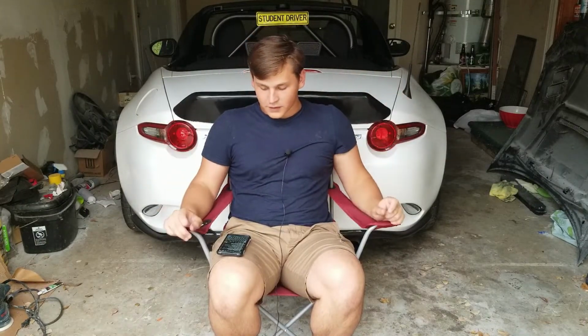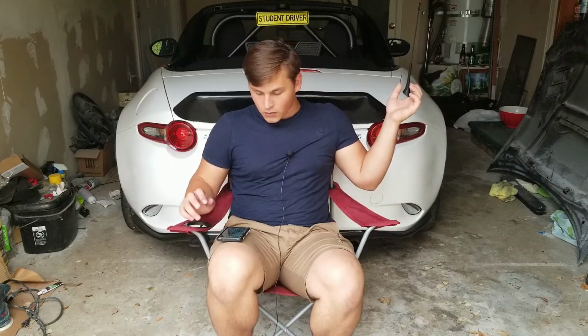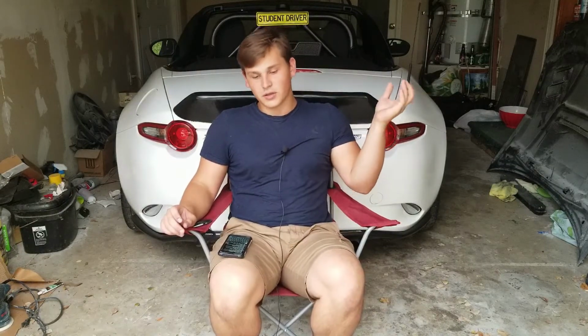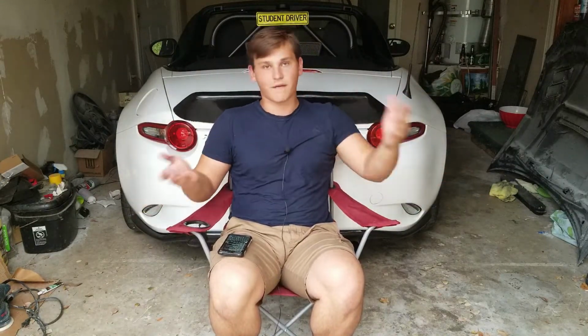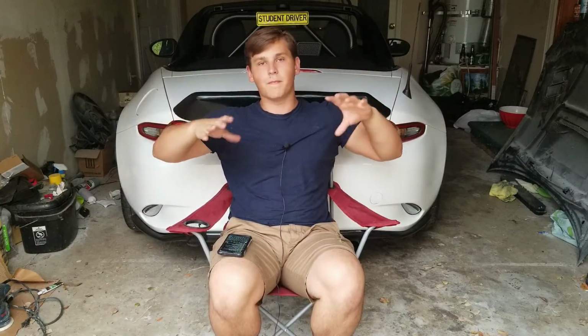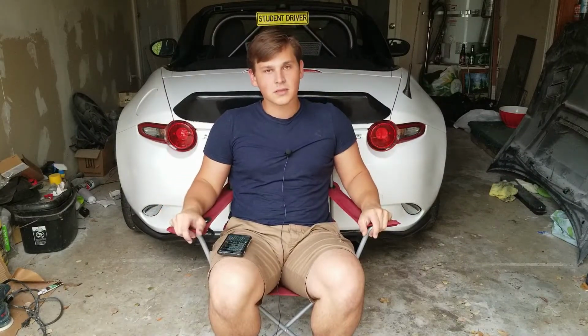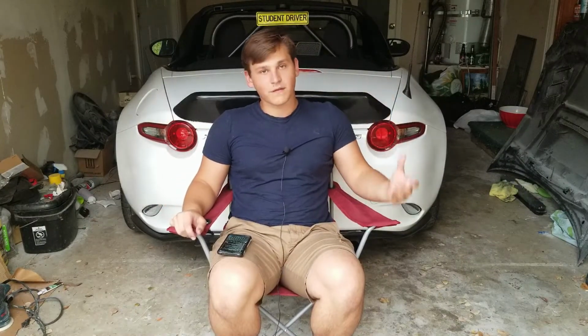So after I covered it, this is now step 4: you make a mold with fiberglass. Essentially you take fiberglass sheet and fiberglass resin, and then you put it over it. I did 3 layers, which should actually be enough for a mold, especially if you're only going to use it once. So then I made a mold with the fiberglass.